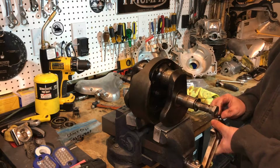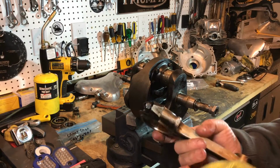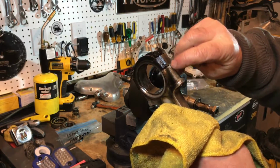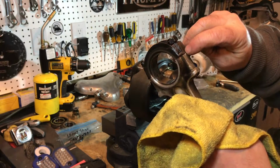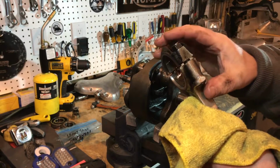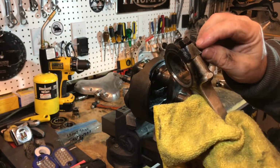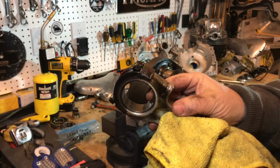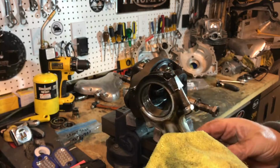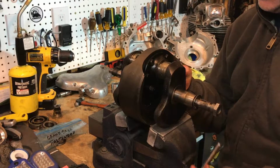Okay, that's the conrod removed. And one of the key features to look out for when I'm reassembling this is that there's a mark there, a witness mark. I think it's made by a chisel or something like that, that identifies the correct end or the side of the collar that attaches to the conrod here. So if you can see that, that'll make it a lot easier when it starts going back together again. And we're just moving it back round to the timing side.